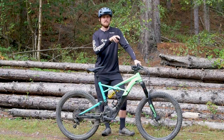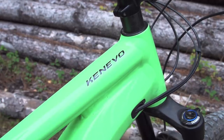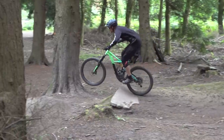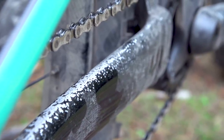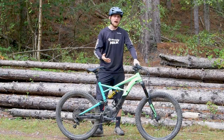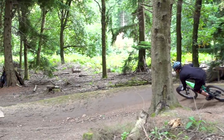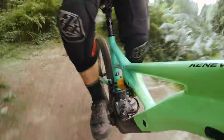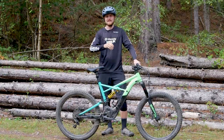While I'm a fan of the slack 65.5 degree head angle, I did find the reach could do with being a bit longer — about 478 millimeters in extra large according to Specialized. There are much longer e-bikes which provide a more comfortable position both climbing and descending. A couple of other niggles: the chainstay is unprotected and makes an awful lot of noise from stock — easy to tape up but you'd expect Specialized to have sorted that. Also, the motor is very smooth and quiet, but it's a little too laggy. If you pause pedaling for a corner or to time your pedals around a rock, it takes a long time for the motor to resume assisting, leaving you pedaling through treacle in too big a gear.